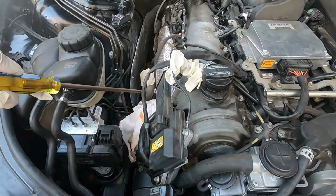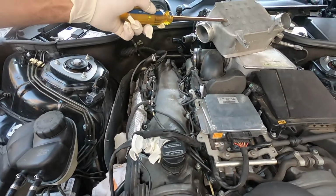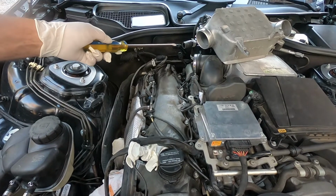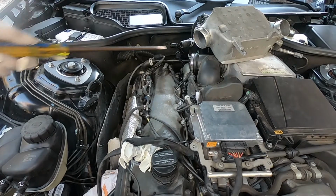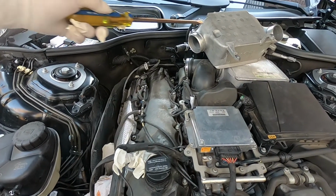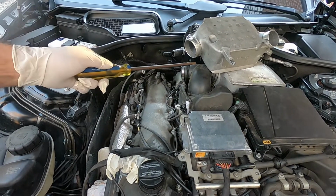Here we see the discharge of the compressor, and it's going to actually go through this aftercooler, and it has its own separate cooling system. It has its own separate circulator pump, its own separate radiator out front, and what it's trying to do is bring the temperature of that air back down to increase its density.